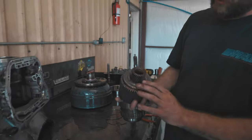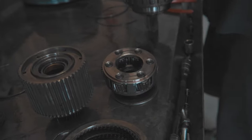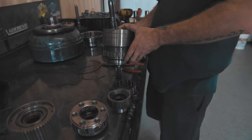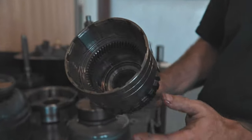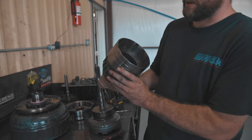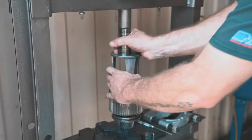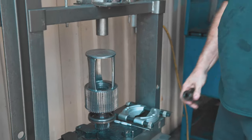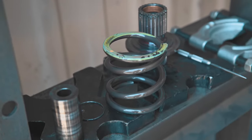Okay, and then the grenade - this is the real grenade. We'll take it apart in a minute. Bearing, more gears, more gears, one-way sprag. You get that in backwards, you know it real quick. And bearing. And that's it. Then you got some snap rings in here to take this dude off, and then a snap ring back here - you can press the shaft out and press the bearing off. All that's pretty boring and nothing ever really happens right there. If you make a whole lot of power you can break all this real quick. I'm gonna force it this time. Hey! Yeah! See? Your hand was close there. Nice. That's the grenade - that is a big spring. That's the grenade.